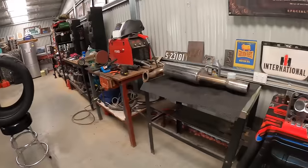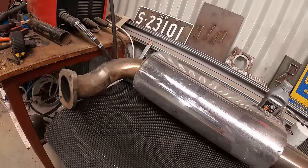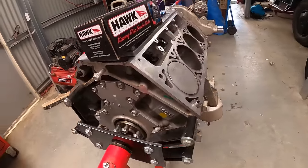That's what all these young players do — they reckon it sounds great, straight piped and all that. You'll get a massive fine from the police, you'll get a massive fine from the EPA, and the other thing is you'll go to Wakefield or a racetrack and actually get black flagged — it's too loud. And actually, it sounds like arse. Whatever you do, don't try and fit the biggest exhaust you can to your car. Fit the exhaust and headers that are actually tuned and make your car perform the way it should. These exhausts are actually designed to have some back pressure, and if you don't have any back pressure, you will rob your engine of power. Don't get the wrong exhaust — don't have a straight-through life.